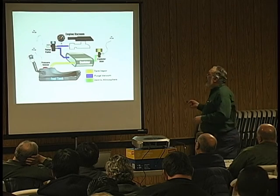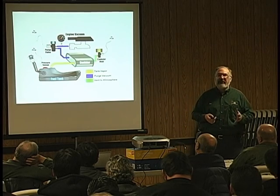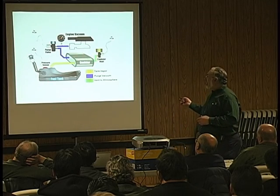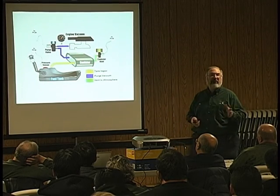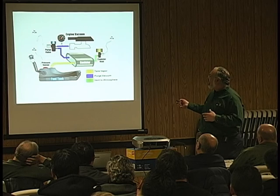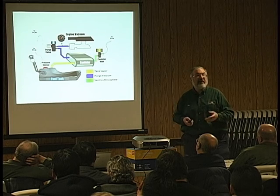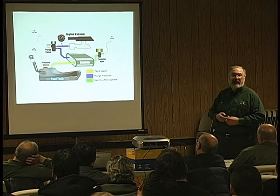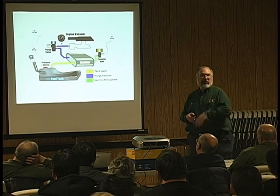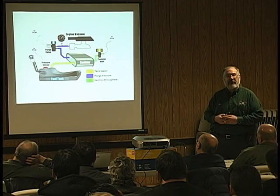You have all kinds of things that could be above that spare tire. You could have spiders, you could have dirt, silt. Sometimes I check the line, but sometimes the little net in the canister that holds the charcoal breaks apart, and some of that charcoal goes in there. If you see charcoal pieces in there, you're going to have to replace the canister. So, needless to say, we put a canister vent on it, took it for a drive cycle, went through the drive cycle, and the process didn't have any further problems.